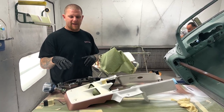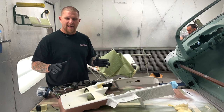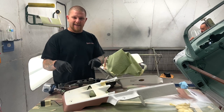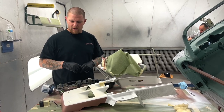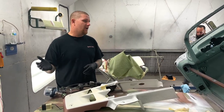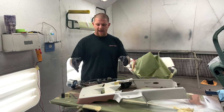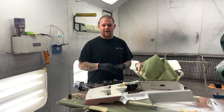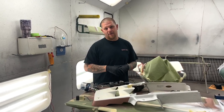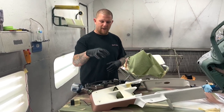For this particular project we're going to be putting lace and graphics over it and by the time we finish our airbrushing none of that's going to matter. But these are some of the challenges you have. When we go and light this next with the conductive top coat we're shooting at very high PSI — like 60 PSI with a wide fan and the needle choked almost to nothing. All of those things will show what it's going to look like. The panel may look splotchy when done if you do not have the conductive top coat applied evenly.